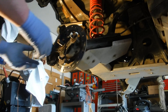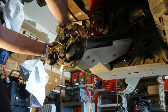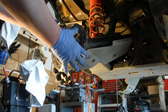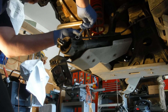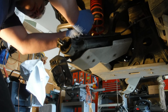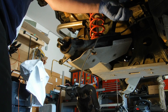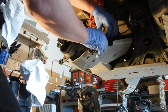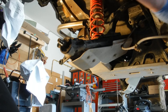You've got a washer and a nut, then we've got a brake caliper — two 15-millimeter bolts that come out. There's the rotor. You've got to take the brake line off this swing arm. So we've got a 10-mil bolt with a 10-mil nut, then a Torx T30 screw up here. We've got to get the line out of the way of the swingarm bolt. There's the brake line and the caliper.